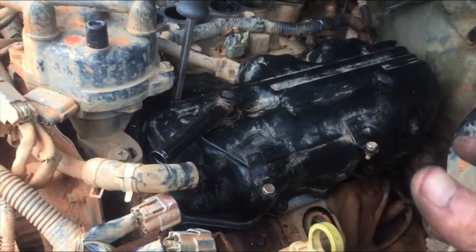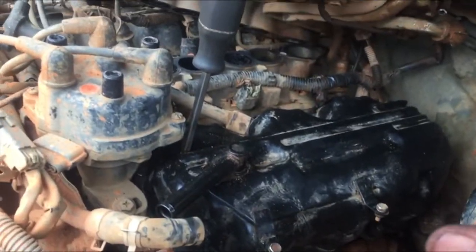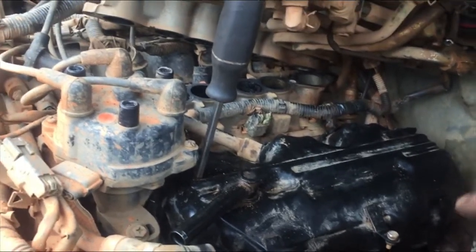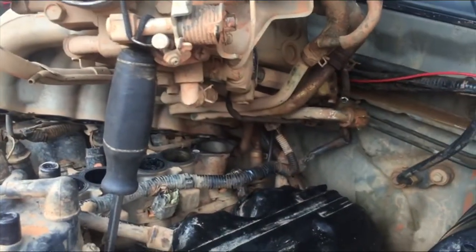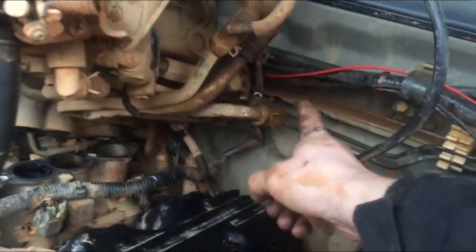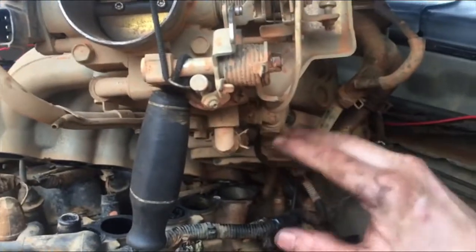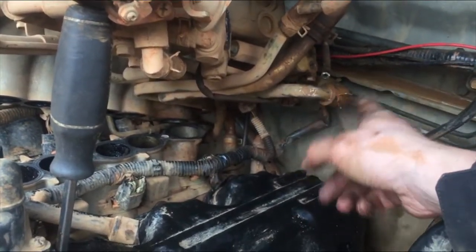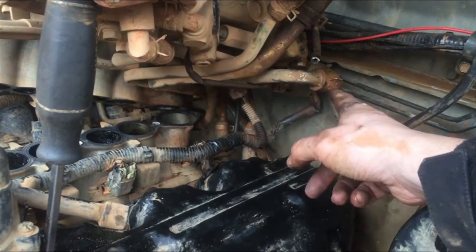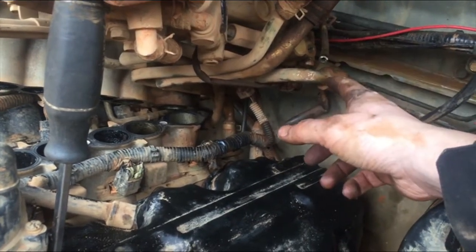Oh well, the best I can, because I have the parts washer at work, and that's what I normally do: pressure wash it, and then throw it in the parts washer. Well, for the 3.3s, you got this intake plenum, and you got two hoses in the back. You got this 90-degree bend, and then you got a straight hose back here. In order to fully remove this, you'd have to cut both those lines. Reason being is these clamps a lot of times get seized or break in these hoses. Well, they're hoses. They don't want to come off. So you got to cut them.